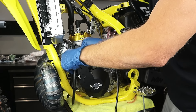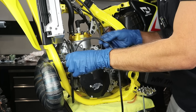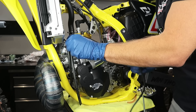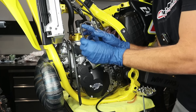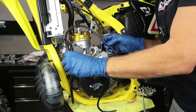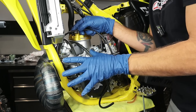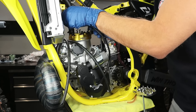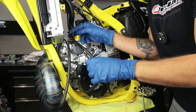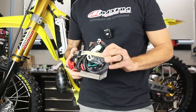Next up, install the breather hose. You saw the 90-degree barbed fitting on the back of this starter motor housing — snap it on there. For safety you can put a little tie wire, safety wire, or zip tie on it. Panthera recommends routing this no less than a foot above the unit itself and leaving a loop at the top, so rather than cutting it and having it stick straight up, you won't have any water getting into it — a drip loop, if you will. I'll probably run it up with the ignition wiring and find a nice place for the loop, then flip it back down around the fuel tank mount.